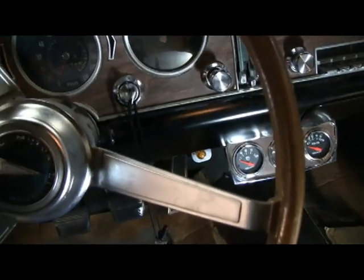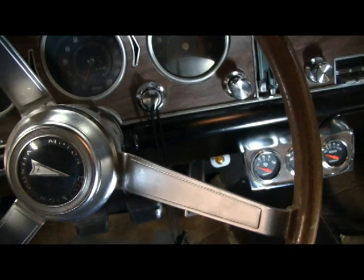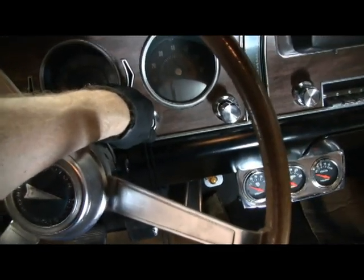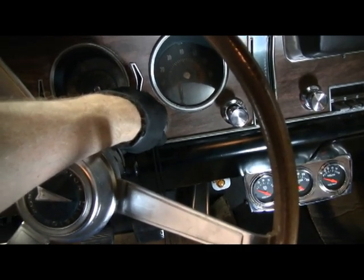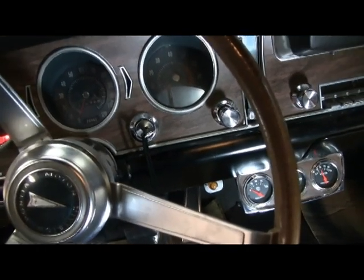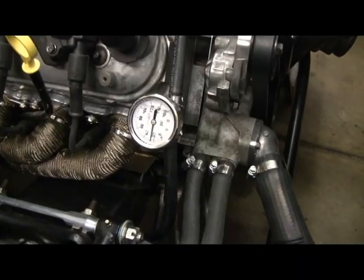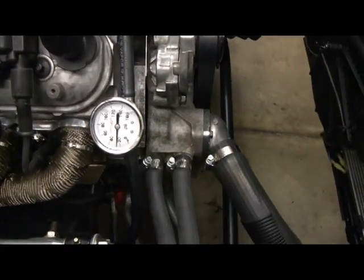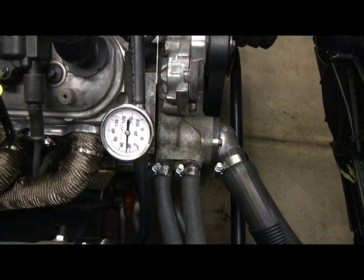Before I program, I want to make sure that the fuel pump works and that it builds pressure. I put some gas in the tank and I'm going to put some power to the computer and the fuel pump and let's see if it'll build pressure. You can hear that the fuel pump's pumping — it just stopped. According to the fuel gauge, we've got about 25 to 30 PSI, which is about right. It's not full pressure — this is only a priming mode. Once the computer's programmed, then it'll go up to full pressure.